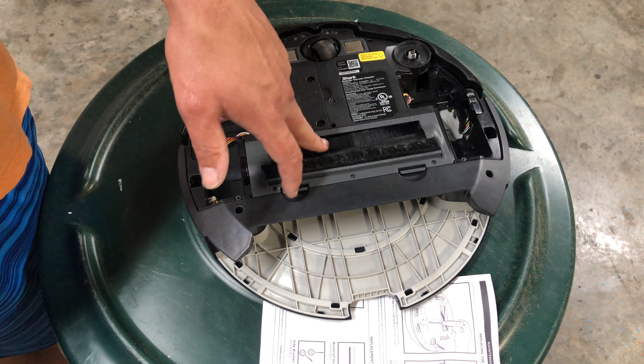Next: dock flashing means the boundary sensors are reporting an error. I've seen this triggered by any of the sensors — the black ones, the clear ones, the side ones, or the two up front and the ones in back. They also used to have little modules that shoot a beam to create a boundary — those could be an issue too. Clean all sensors with isopropyl alcohol, 70% or higher — I like 91% because it evaporates fast and is safe for electronics. Turn it off, clean everything, then put it back. Also note: the little black strip inside can get scratched and cause errors.